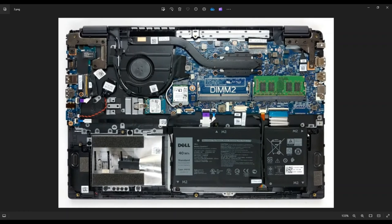To get this battery out, you have four screws near each of the white triangles. The battery plugs into the motherboard right here, so you have a choice of where you want to unplug it from. If you unplug it from the top connector, as with any cables and wires in a computer, try not to pull on the wires — try to just manipulate the plug. This plug has a grip on either side; you can use your fingernails or a pry tool and wiggle it right out of that port. Or you can unplug it from the other side — that's just a snap, and that's how you get your battery out.